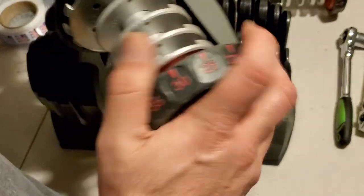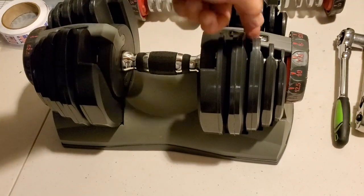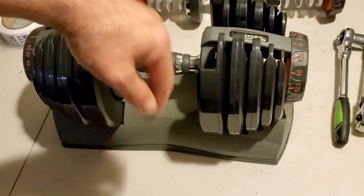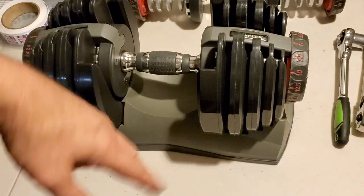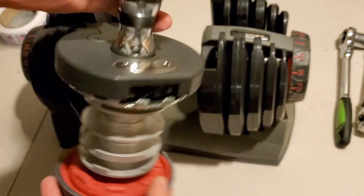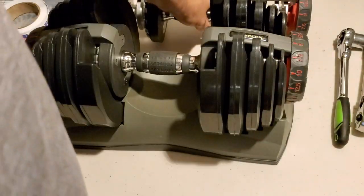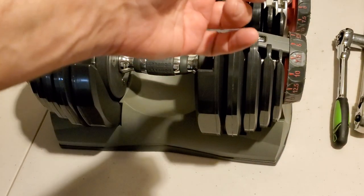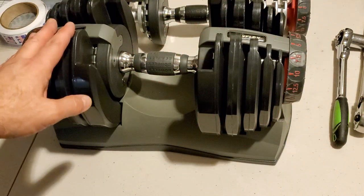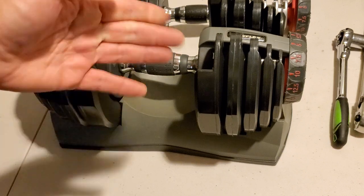The handle functions properly, it's locking properly, it's inserting into the existing plates properly — now it's ready to use. I would feel safe using this dumbbell. But don't just put the upgrade in and then start exercising — that's not safe because you don't know yet if your handle is assembled like this. There's actually a loose ball bearing in here now because of the play on these plates. Hopefully that helps you understand not just the properly assembled handle versus what it looks like when it's incorrect, but also how to do your safety pre-test before you start exercising with your dumbbells. Thanks for watching, guys. Hope you have a great day.